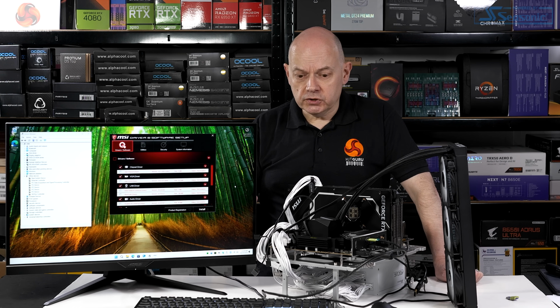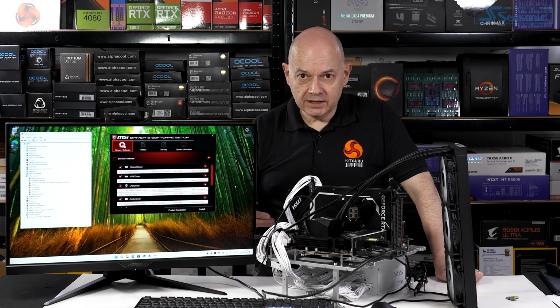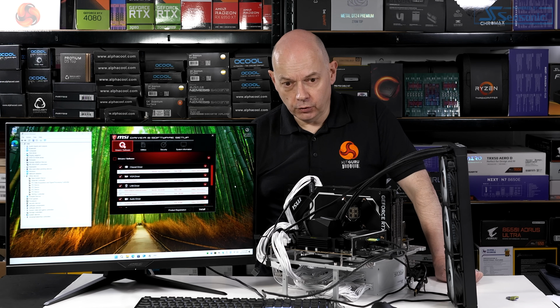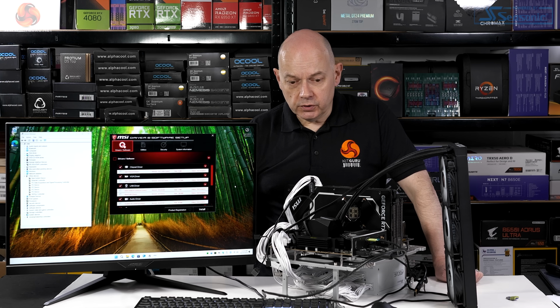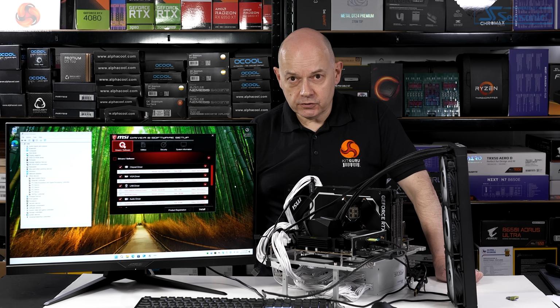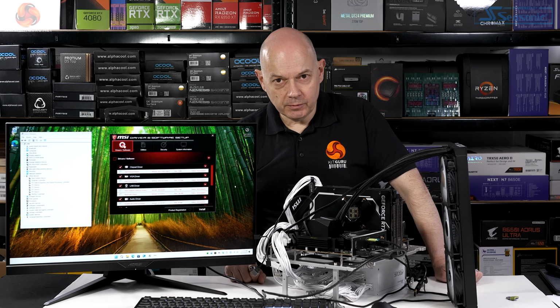So 4 options. You use the update software that comes with your motherboard, and it generally now will automatically prompt you to install it. It's an option in the BIOS which is set to on by default. You can run the driver disk. You can go to the motherboard manufacturer's website, or if you're a reviewer, you can do this very similar approach.